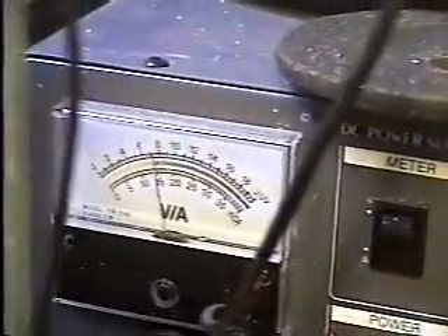With just that little bit of sodium hydroxide inside with fresh water, and using the tank to supplement the water as it's used, you'd end up with just 15 amps — no more than 15 amps. That's less than the blower motor on the air conditioner or heater in your car, which is usually fused at 25 to 30 amps. So that shows you it's not using very much current at all in order to produce the amount of hydrogen and oxygen gas — HHO gas — that you're seeing. And that's about it for the SuperGen Series 9 by MagDrive.